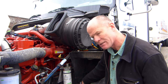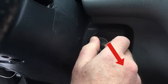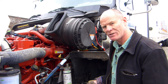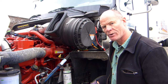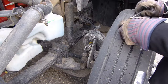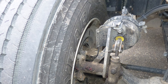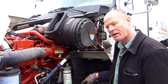You can see there's a wire on this one which means the brakes have ABS on them. You'll also be able to tell that from the dash because you'll turn the key to the on position, wait momentarily and the ABS light will come on and then go out, which means the ABS are working normally. For the purposes of this pre-trip inspection test, we're going to use the pry bar method. Essentially you just put the pry bar in here and half to three quarters the width of your thumbnail in terms of pry bar for the slack adjuster. The slack adjuster and all the components of the brakes and the inside of the hub are all secure, not damaged.